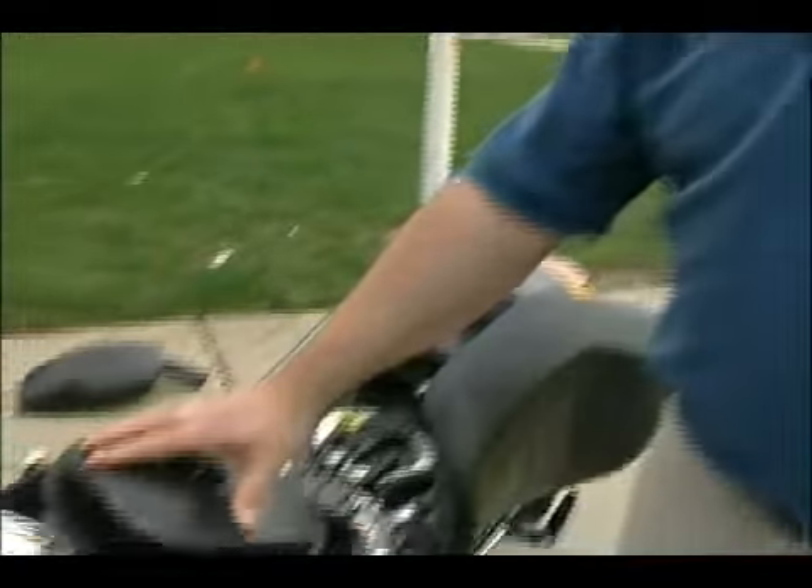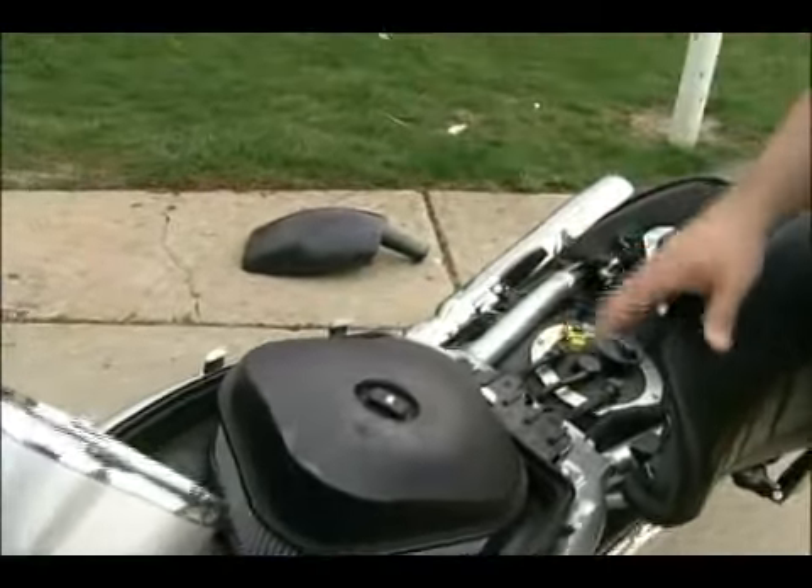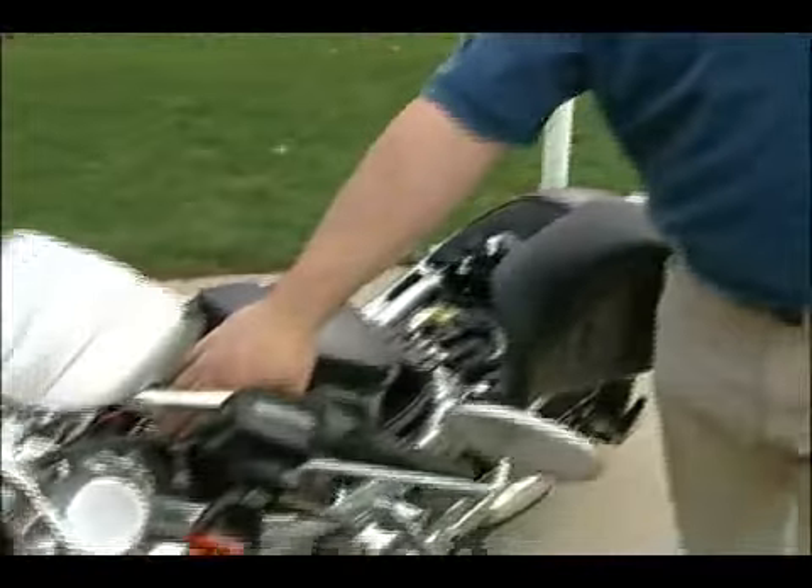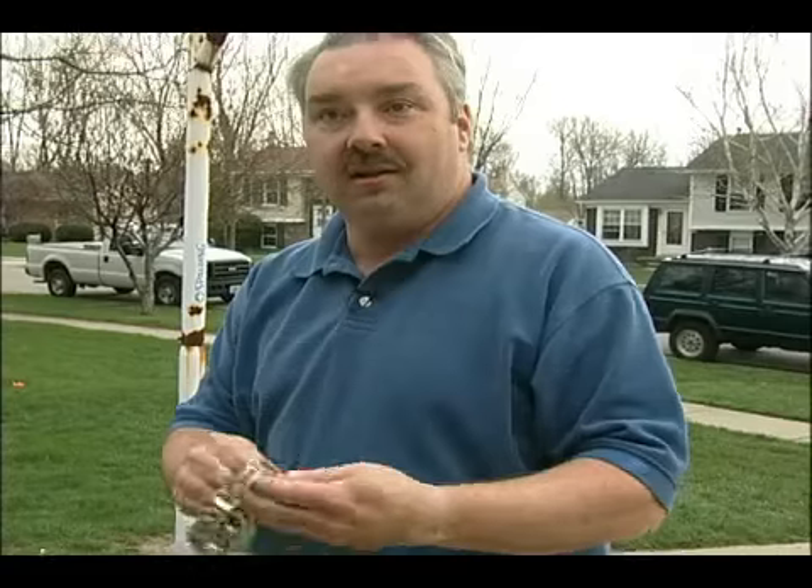Now that we have the cover removed, I always go for safety. Up here is the battery — we have the positive and the negative terminal. Just personal preference: I get rid of a ring and a metal watch band that could conduct electricity. I'm not in the mood for any shocks or surprises, and neither should you be. So just get rid of those for now.